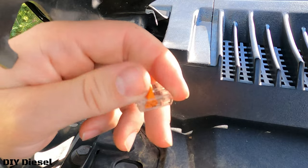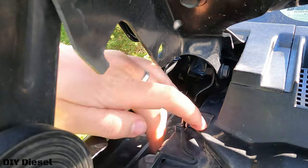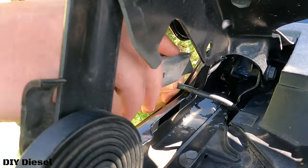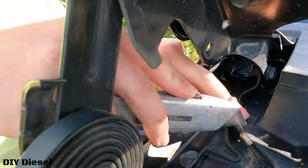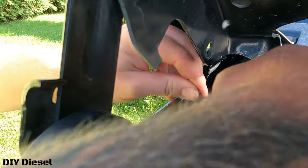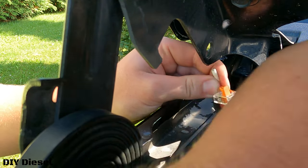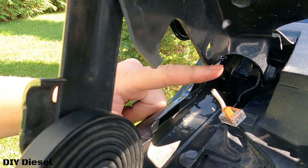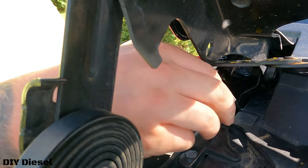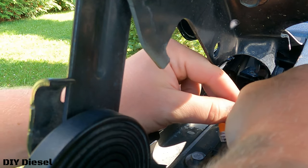These are just king. Now, when you're stripping this out, you're going to want to strip off the black rubber coating, and then you're going to have a silver steel looking aluminum conductor as a shield, you could say, because it really is a shield. That is going to be your negative. And then you're going to have the little white piece in the middle there, and you strip that back to get to your center wire, which is a copper wire, and that's going to be your positive.